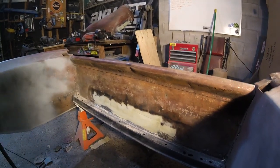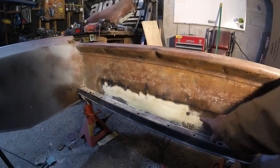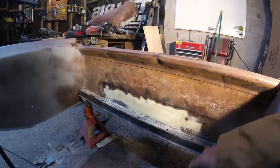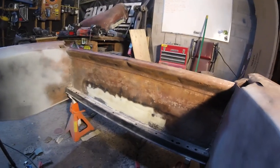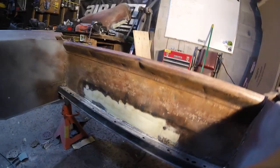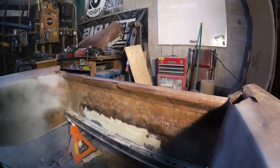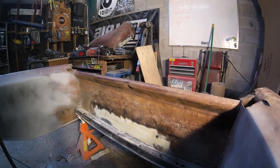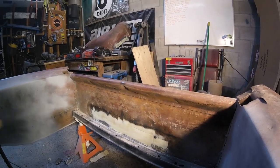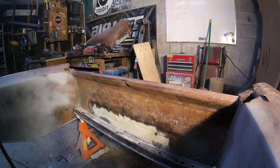The next area is the opposite side of the panel you just saw. I spent a lot of time sanding in here — it's concave so I had to hand sand it. There's a nasty filler gap in there, so I'm definitely going to put some filler on there after I've painted the other side to make best use of drying time. I'm going to have to go over this with some wax and grease remover and a tack cloth to get it ready for filler.